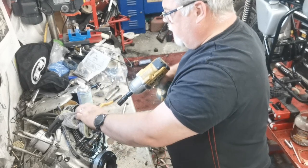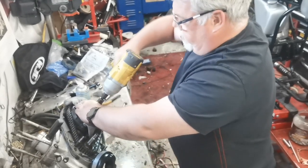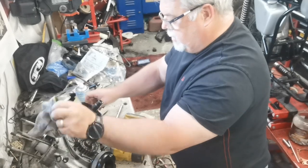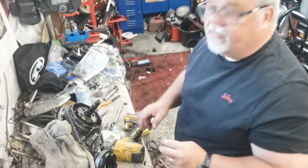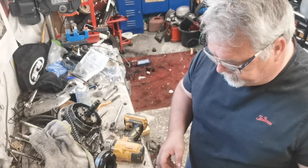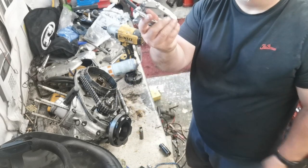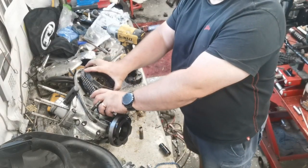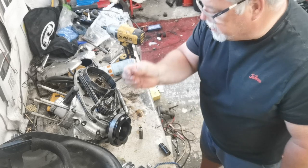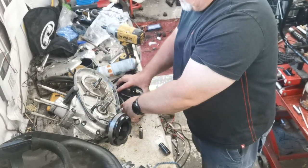Okay, not one off yet. There we go. Well that's off now so I just need to get this side off and then the whole thing can come straight off. This side was a bit stiff so I used a three-jaw puller on that one. Now we've got both sides working. The woodruff key came out so we'll need to find somewhere to put that so we don't lose it. The whole thing just slides off like so.